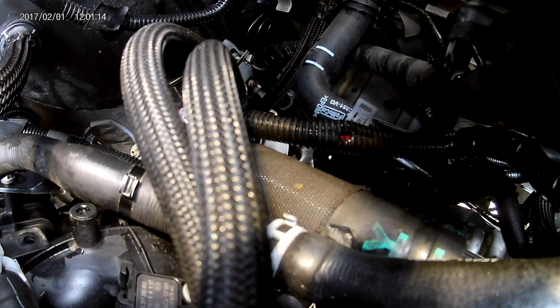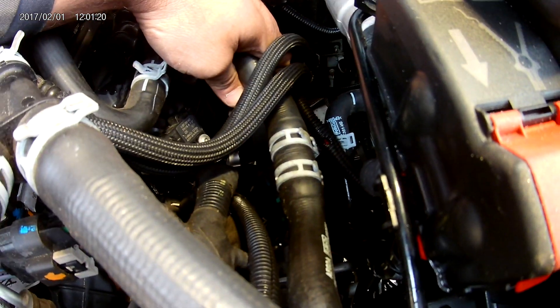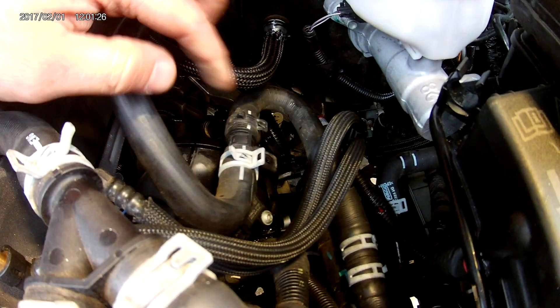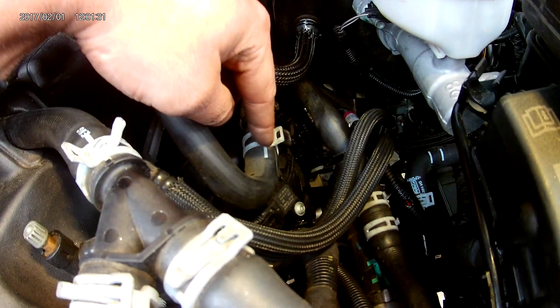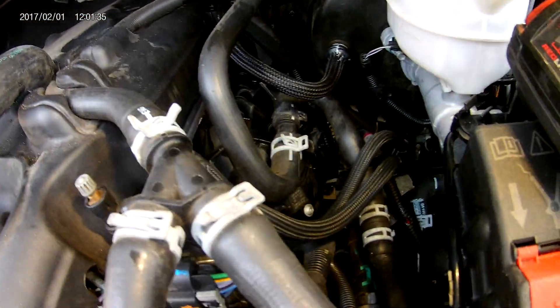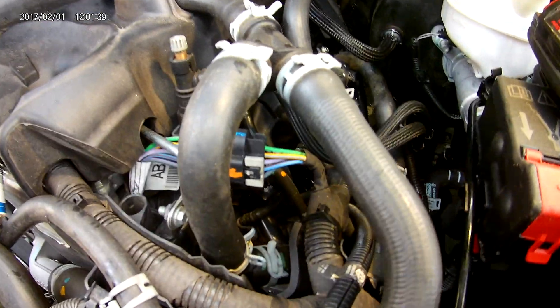It actually started cutting into the cable as well. When I say disaster, I mean why have that many clamps and pieces in a heater hose? As you can see, it's pieced here — we make a loop, we have another mounting bracket here with another coupler, two more clamps just to get back here. To me that's overkill, but I'm not an engineer.